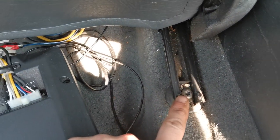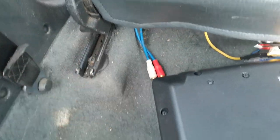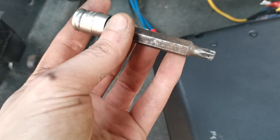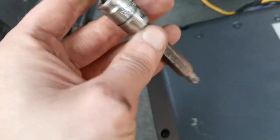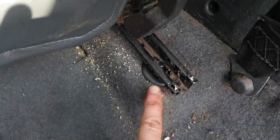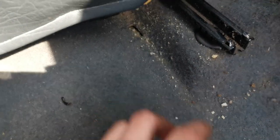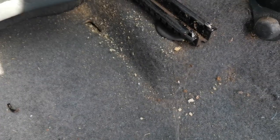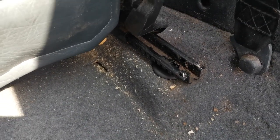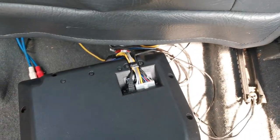On the back of the front passenger seat and the back of the front driver's seat you've got a T40 Torx there - a T40 Torx with the T40 bit. Excuse my rusty tools but that is a T40 on the 3/8 ratchet. I've done the driver's side ones already and they come out just like that with the washer on them. That seat now is moving when I take it off. I will push that back again and we'll reveal the ones at the front in a little while - first of all I'll take these out and take the base box out.